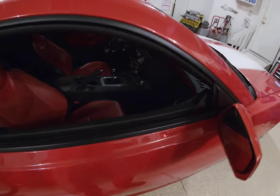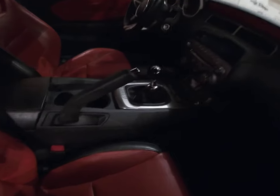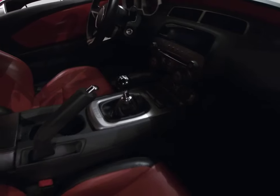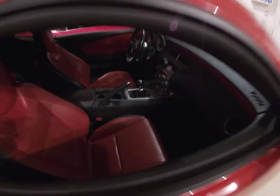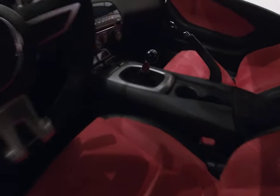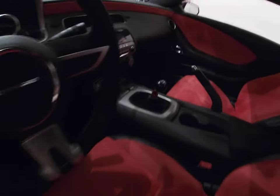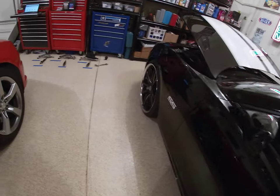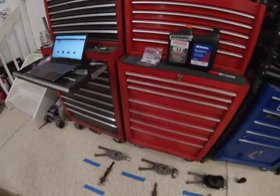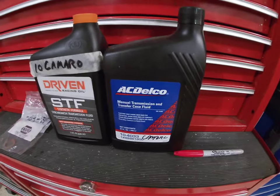Some people put one washer in; I put two in. Under the car there is a detent spring that you remove by just taking a bolt out, essentially putting a couple of washers in, and away you go. The Camaro is a little tougher though based on the floor pan design — you can't really see what you're doing, you're going to have to get your socket up in there and it's a sense of feel. It takes a little patience, but for me the notchiness went away completely.